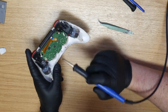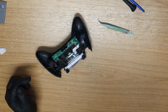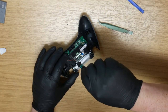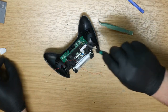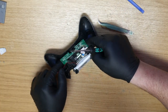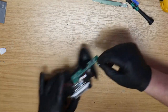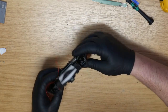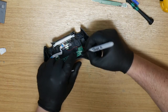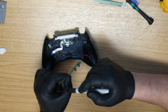We've got two analog sticks there. Let's start on the rear board — I haven't done a video on one of these before. Scuf tend to chop and change with these Impacts — sometimes they have domes, sometimes micro switches. Looks like micro switches — brilliant. Let's put it back in and mark which one needs replacing. Flipping the board around every five seconds, you end up replacing the wrong one.